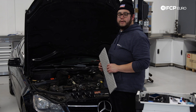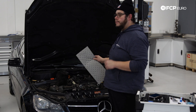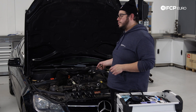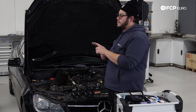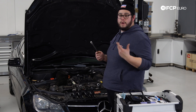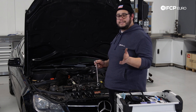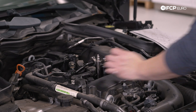Now we're just going to go ahead and turn the motor over a couple of times. This engine specifically, the spark plugs came out submerged in oil. So we're going to lay this over the top, crank it over a couple of times just to clear the chambers, and then compression test it. Now we have our proper adapter for our compression tester. We're going to go ahead and get it situated in cylinder one, and then we'll repeat the steps for two, three, and four. Most compression tester kits are going to come with different attachments that have different thread pitches depending on the spark plug thread that your engine uses, so just make sure you find the right one. Start them all by hand — you don't want to cross-thread your cylinder head by accident. Once you have that situated on your tool, go ahead and feed it into the cylinder you're going to test first. Write down your numbers once you get six to eight compression strokes on the gauge and then repeat for the rest of the cylinders.